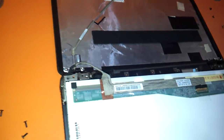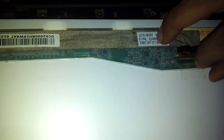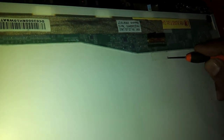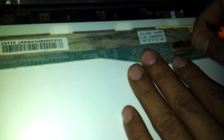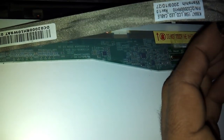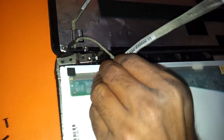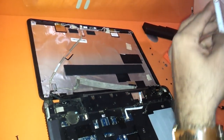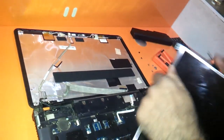I can just reverse the LED — it's basically the LED that we have to replace. We just need to very gently remove the cable. It's very firmly glued to the screen, so be very very gentle on removing it. You just need to remove this cable, and the cable comes out as you can see. And you have these screws that you have to remove so that you can replace the LED.